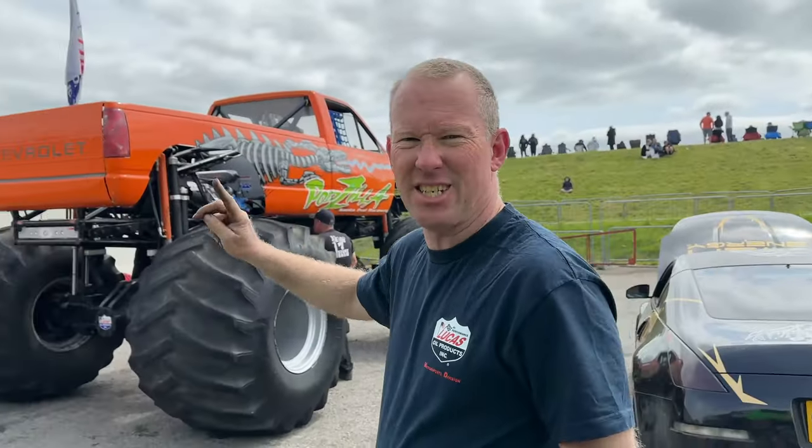Also, on Podzilla's truck at the minute, he's actually got no oil pressure. They've cracked the fitting off to where the oil should be coming out of, and there's no pressure coming out of that. So I said, just pull the distributor out now. The bit that can sometimes break, you can actually snap the gear off the bottom of the distributor, because the camshaft actually drives the oil pump from the distributor. And I've had it where that bit's fallen off. So they're just going to pull that out now and see if that is the problem.